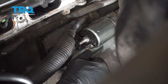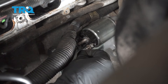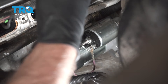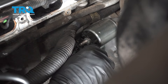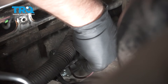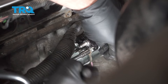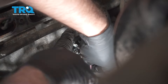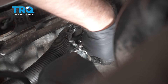Put the signal wire on first — just line that up. There is a lock washer and then a nut. Tighten that down. If you can get a torque wrench in here, torque this to 20 inch-pounds. Make sure you're on inch-pounds, not foot-pounds — it's not very much, just snug, but 20 inch-pounds.